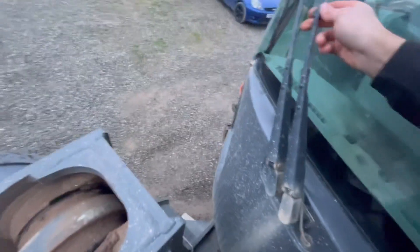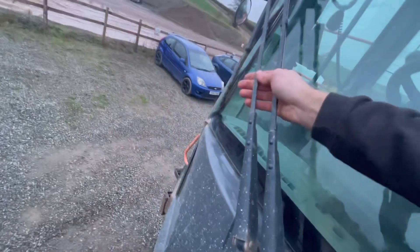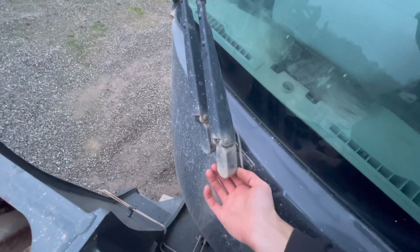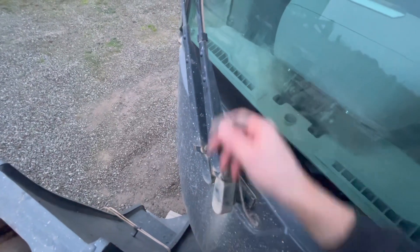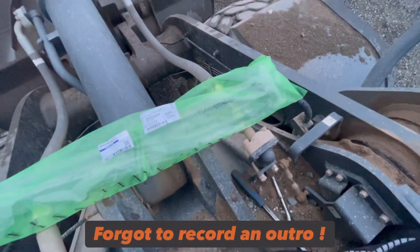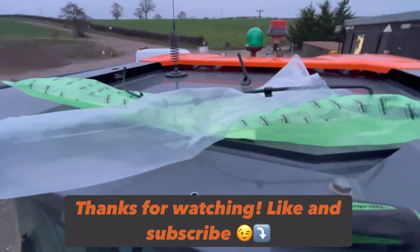Last job of the day - the 420 wiper arm. I'll show you what's the matter with it - the wiper arm's got loads of play in it. See how the spindle isn't moving but this is - it's all playing at this joint here - and what happens is it's coming off the windscreen. When I spoke to the driver I thought it was loose on the spindle like the other 420 we did, where the spindle was knackered, but it's tight - it's playing at that joint. We've got a fresh one, we'll replace it. That's the new one on - nothing too exciting - the old one's in the van.